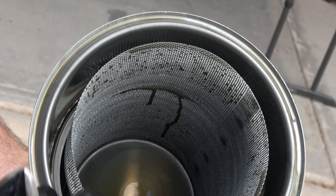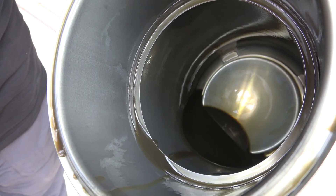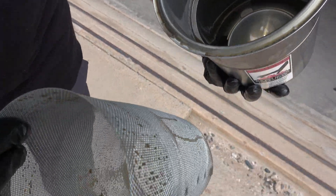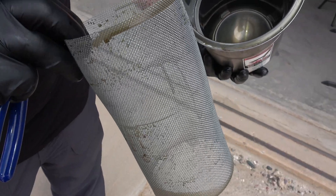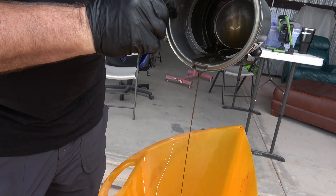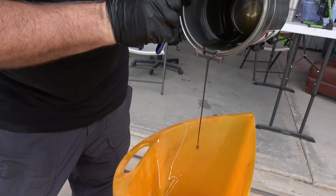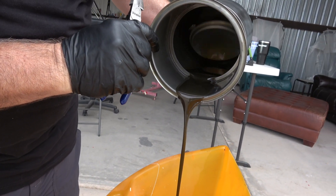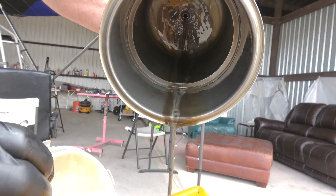You can see the bottom portion — notice that it's perfectly clear of any sludge. That's the baffle that sits on top of the canister, and this is the screen. The screen fits down inside. As I start to pour out the oil from the very bottom of the canister, the baffle pops out. And then underneath the baffle you can see where the actual sludge is.